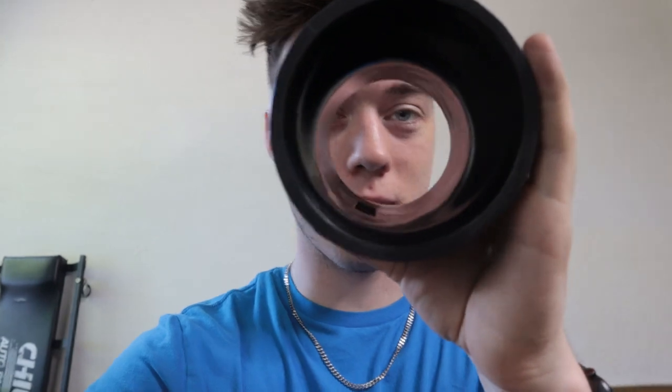Something worth mentioning: this cold air intake comes with a little insert tube. This is for running the car without a tune, or if it's tuned for the factory intake — you can still run this cold air intake setup with the insert inside, which limits the amount of air coming into the engine so it runs like stock. Since I have a tune for the performance intake setup, I'm not going to be running the insert.